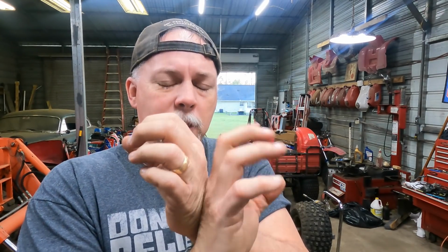These are two-piece wheels, and if you've never seen a two-piece wheel, they're two actual halves of the wheel that are bolted together. And in between those two halves, there's a rubber O-ring that looks something like these. That O-ring sits in a channel, and when you put the wheel together, that O-ring creates the seal. Now, I don't know that that's the problem, but that's what I'm guessing is the problem. And sometimes you just got to take an educated guess.